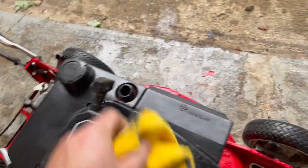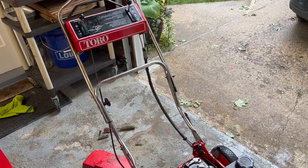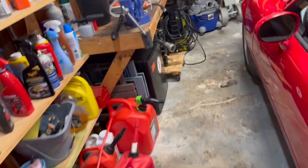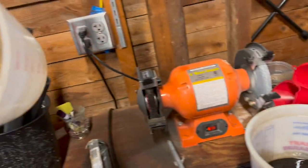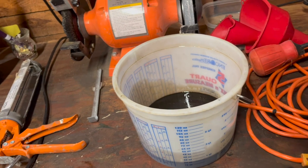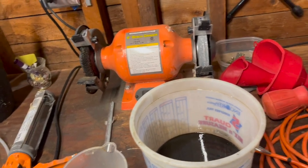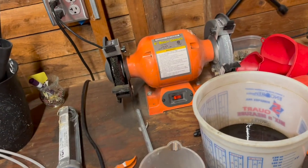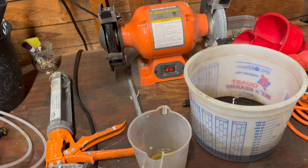I know, right? They're really downplaying the need for oil changes, so you'd think they would at least have a fairly healthy amount of oil, a reasonable expectation. You'd be wrong, because 16 is almost half the oil that this thing takes. And the more oil you have in your sump, the more time before it runs out of oil completely, and it also gets dirtier slower. So less oil means dirtier faster.